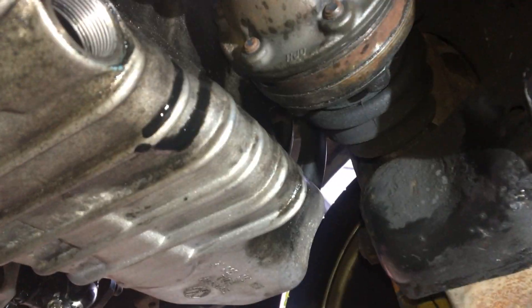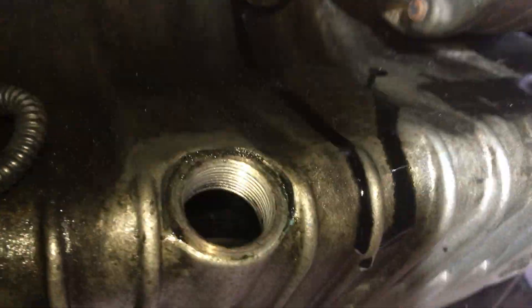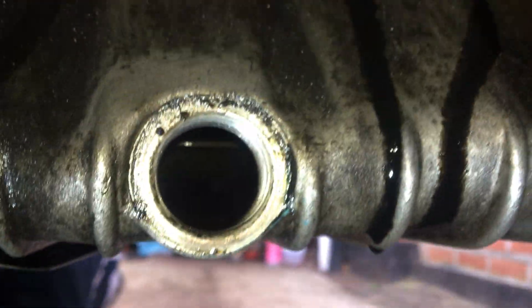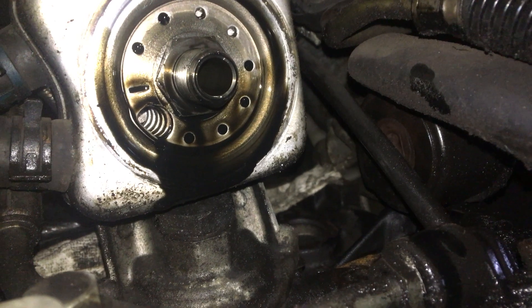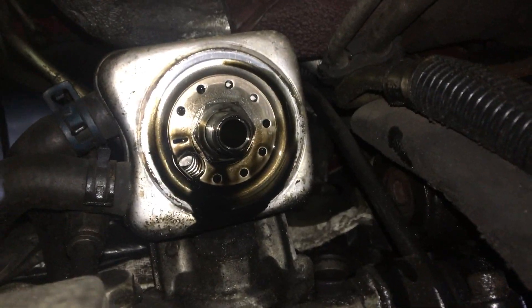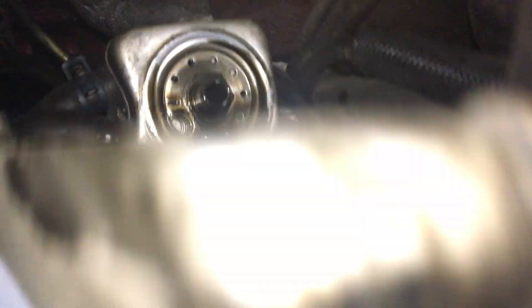All right, let's get under here. Yeah, not a lot of oil leaks. That's the nut there — you see that? Right in the center on that threaded shaft. There's a nut; I think it's 27mm. Pretty sure it is. So we need to remove that, and then we can take the oil cooler off.